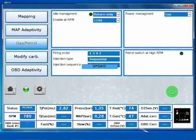Now I make an example. So now we are on gas. Okay, so I will get high RPM, for example 2000, and I will release the accelerator. Okay, now you see that this LED will blink for a moment. It takes a short time, about a second, for example. Okay, you see. So for this time that you see the LED lights on, the engine will turn to petrol.